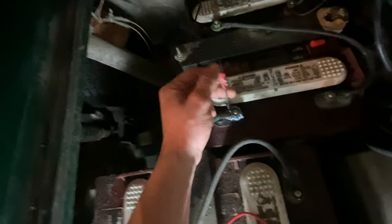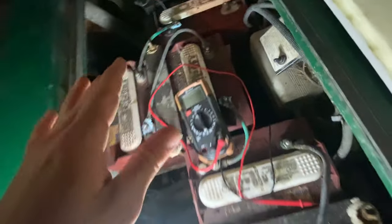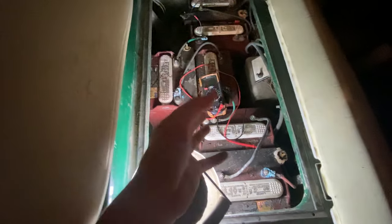But now it could also be wires too. So check all your wires, check kinks, bent, any cracks or holes in your wires, or you know, any rips, anything like that. You need to have good positive connection or it will not go. For the most part, your wires are usually gonna be down here if it don't run. Or it could really be everywhere. You just want to look down here, make sure, okay, this is on there good, this is on there snug, that's on there snug and tight. These that run to the back, make sure them are good. And I guarantee you, if your golf cart is not moving, one of your wires are ripped. And that's basically really all you really need to do.